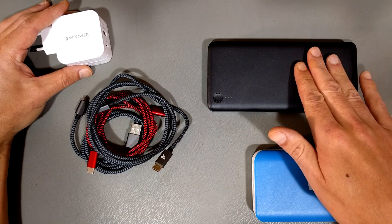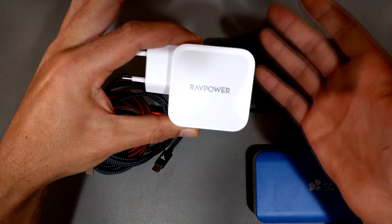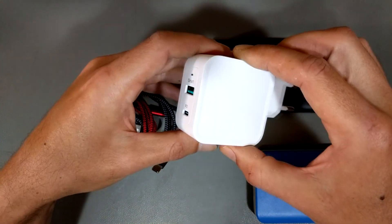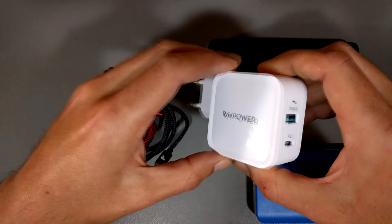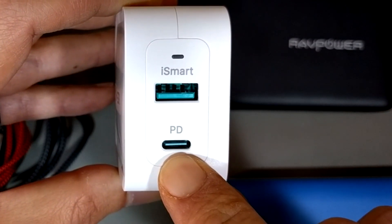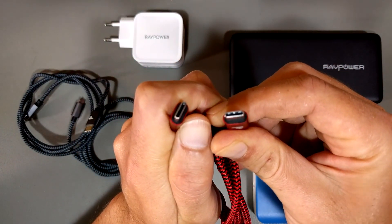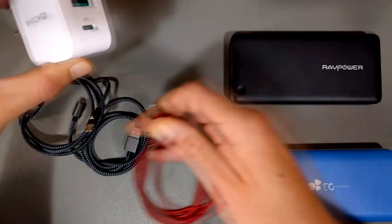So you're going to need a Type-C charger with enough capacity — enter this little RAVPower charger. I should note that RAVPower is not giving me any money for this, it's not sponsored; I just went on Amazon, looked, and finally found these two. This is a 65 watt charger — the beefiest one they offer. This is a European two-prong plug, so in North America you'd have a normal plug. It has an iSmart Type-A USB connector and a USB Power Delivery Type-C port. You buy this charger, this power brick, and a USB-C to USB-C cable and you can quick charge the power bank in about four to five hours.